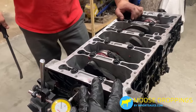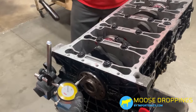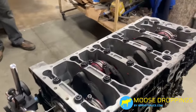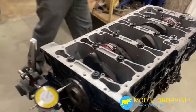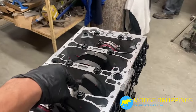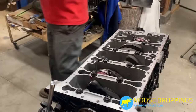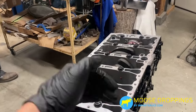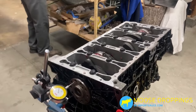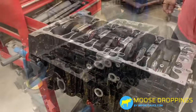One important note: we had already checked this earlier before mounting all the pistons and connecting rods but forgot to mention it. With a dial indicator, we need to check the crank thrust — the amount of front-to-back movement. Per the Volvo sheet it should be 0.08 to 0.19mm. We just put a small pry bar in there, moved the crank, and it was perfectly in spec. Make sure you check this — you don't want the crank sloppy back and forth once everything is assembled. The flange bearing is all set and confirmed.